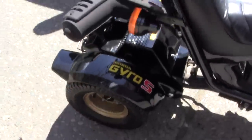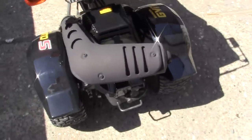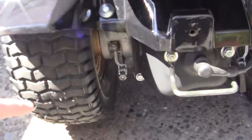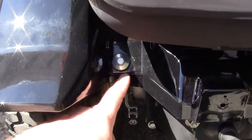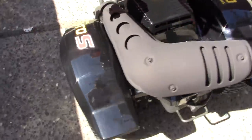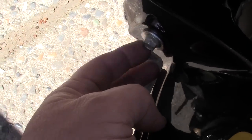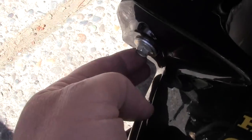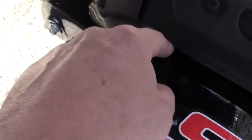This tire over here is fine and I made some quick fixes. This was rubbing on the inside right here — I put a little bit of white paint here and it was rubbing just right up in here. What I did was I put two washers under this right here to lift it up a little bit. Then I got a slightly smaller bolt, took out the rubber washer, and pulled this up about a quarter of an inch or less so it doesn't hit right in here.